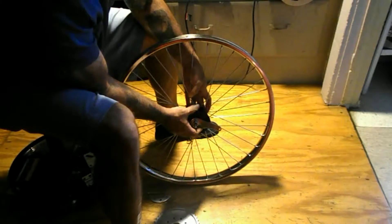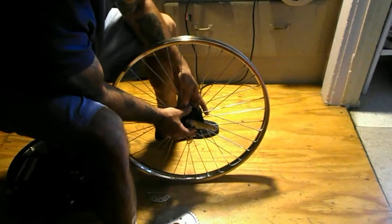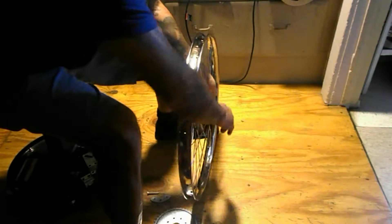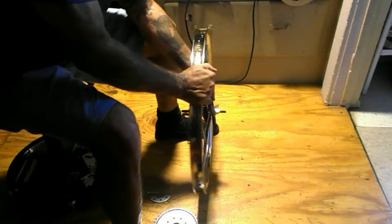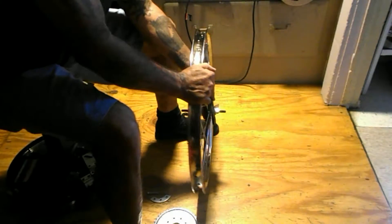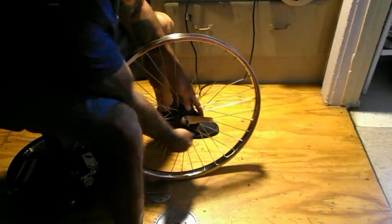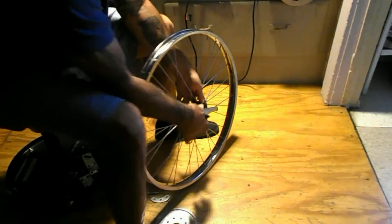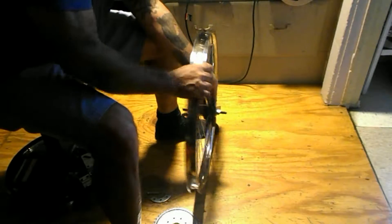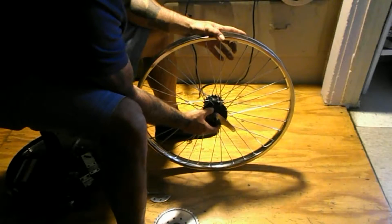This is what you'll experience with a destroyed wheel. As you're driving along, the spokes drive the wheel forward — all the tension and torque is absorbed by the spokes — and it has a tendency to wobble as you go along. When you accelerate and decelerate at 20 to 25 miles an hour, that torque makes the wheel wobble, which puts a lot of stress on it, weakens the joints and spokes, tears up the rag joint, and destroys the bearings inside the wheel until the wheel is completely wobbly.